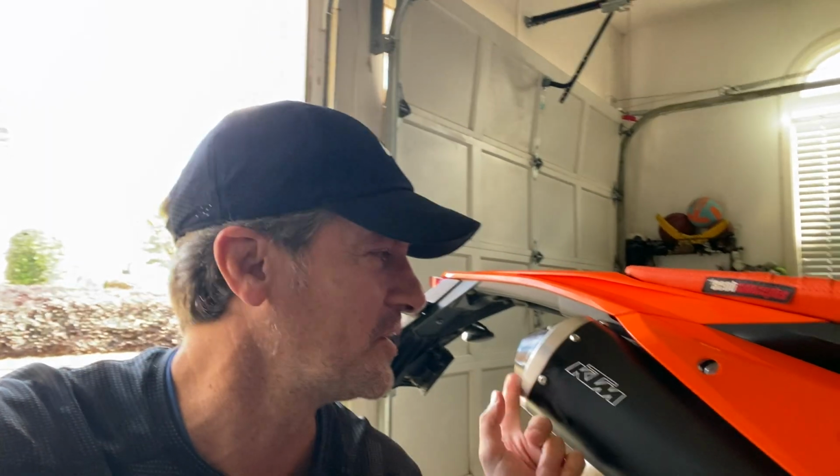All right, well, I'm gonna do a quick decibel check. This time I'm gonna do it with the FASTWAY Pro Moto billet installed. Now I didn't put the ECU yet in there, so it's running lean. I didn't do the desmog. For now, just to get a sense of how loud it is, I'll run it at idle and I'll accelerate it, probably, I'm guessing, about 3,000, 4,000 RPM and see what it sounds like and kind of compare that to stock. And also when I removed the tip altogether, and we'll get this on video so you can compare all 3.